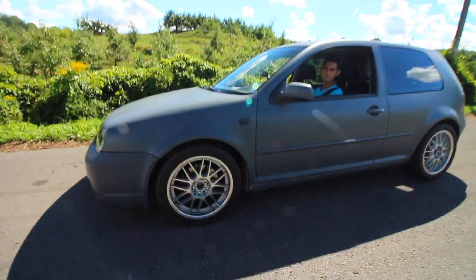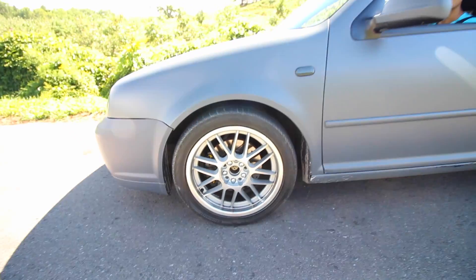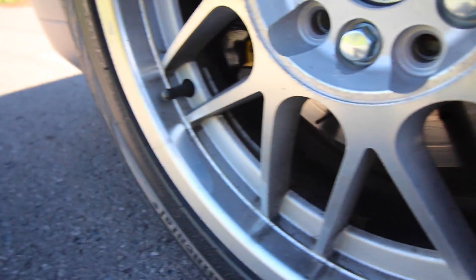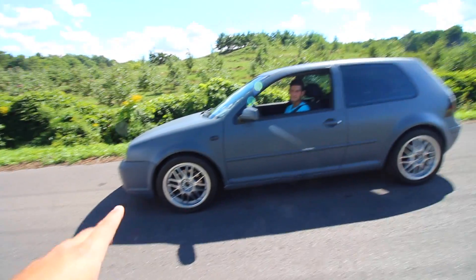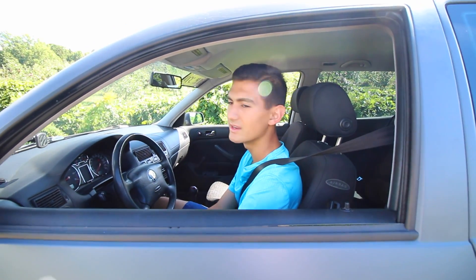Something to consider is that the difference between OEM brake dust and aftermarket brake dust is going to be quite significant. Can you see all the little lines right here? That's from having these brakes on the car for not long at all - not even a day, probably about 300 kilometers. Look at the stock ones - the front brakes with the stock pads were never like this. Braking distance is going to be greatly improved, but the dust is a trade-off. If you want the car to stop very well, upgrade your pads to this. If you want the wheels to stay clean, stick with OEM - though it's pretty easy to keep clean; it wipes off fairly easily as long as you get it recent and don't let it sit for a few weeks.